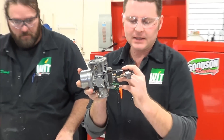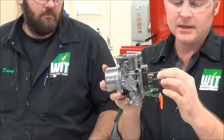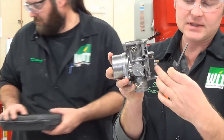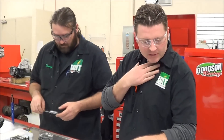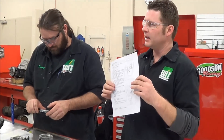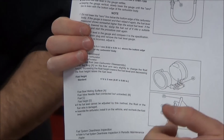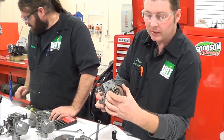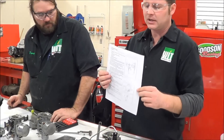What's really neat about this tool is I can take and put it on here quickly to see what the actual float height is set at. You can also go to your vernier caliper — we'll take a look at that as another way of doing it. This surface to the top of the float — where we have to be careful, just the other day we were doing a Kawasaki Prairie and they made a big deal that we need to be to the bottom of the sealing surface. The edge of this is flat, so it's easy. You need to follow the service manual procedures so that you can be exact.